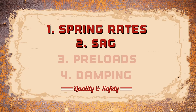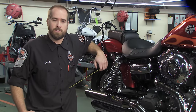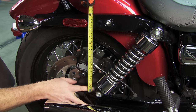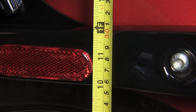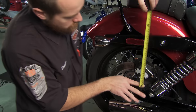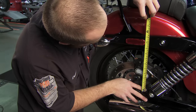Next, sag. The amount of sag in the front and rear suspension controls the ride height and steering. To adjust, measure the height of one end of the bike with the suspension fully extended. Raise the end of the bike until the tire is off the ground. Then, while extended, measure the height from the top of the bike. Load the bike with all the weight it will carry — add everything: yourself, bags, and passenger.